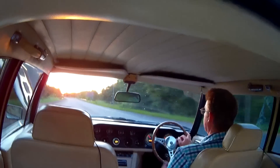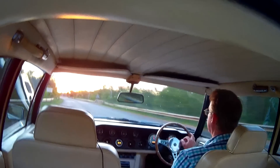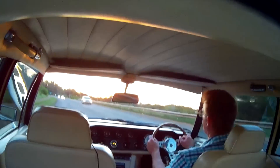Here's Philip's impression of the conversion with the ECU and fuel injection. Fuel consumption on the open road is about 14 litres per 100 kilometres. Starting is very good, cold start is positive, and the engine is very powerful at low RPM.